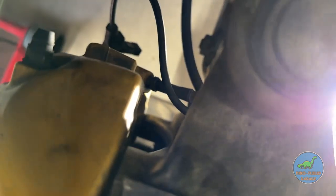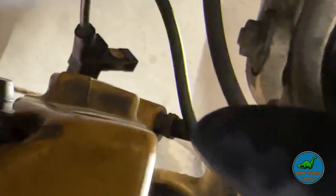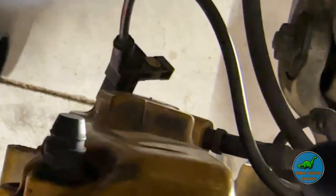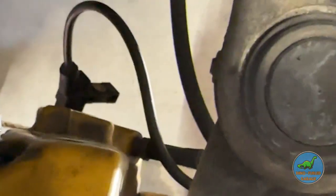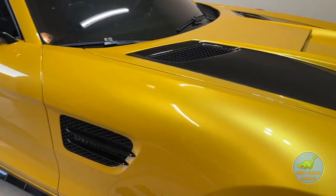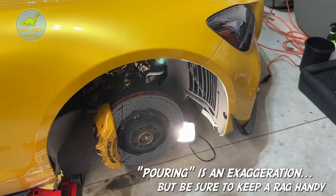If you look right down over here, that is your brake line going into the caliper. That is an 11 spanner. So you'll just go ahead and undo that one and get ready to have either a spill bucket, or some tape or some stopper to stop that line off, because you will get brake fluid pouring out. I'm going to tape it — we'll see if that works.